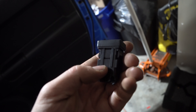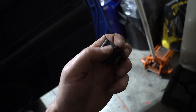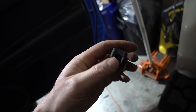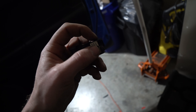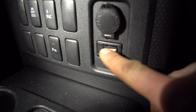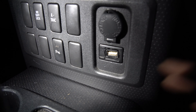Put the two screws back in the bottom. Here's another little trick: pop this by putting a flat blade in here and here, popped it out, took out the old AUX port, and dremeled it out. Doesn't look the best but I'll clean it up a bit. Then I drilled two holes in here to bring the zip strap through, zip tie the cord right here, and have my USB sitting right there — nice and flush right in the same hole where it was. There's your deck — she's in there. If you wanted to, you could even use some black silicone and just seal it in here.